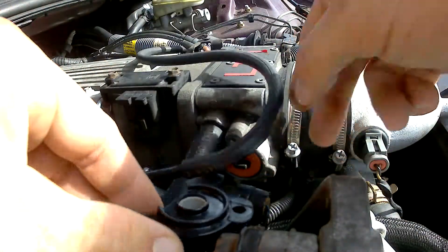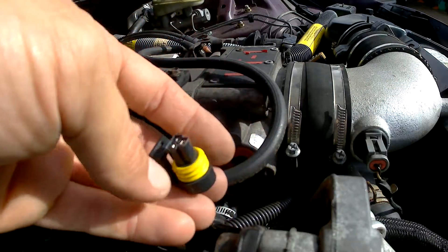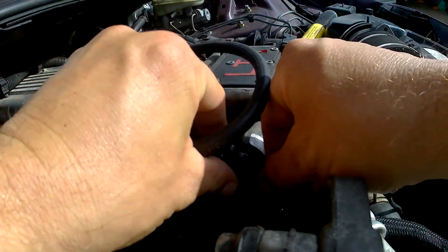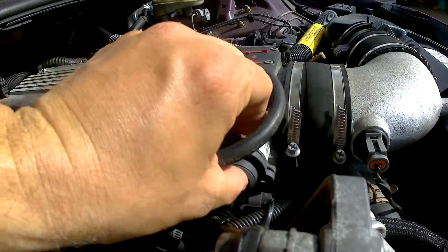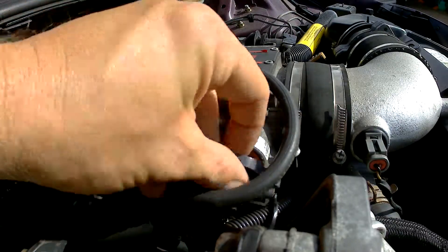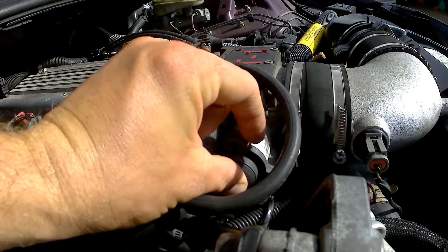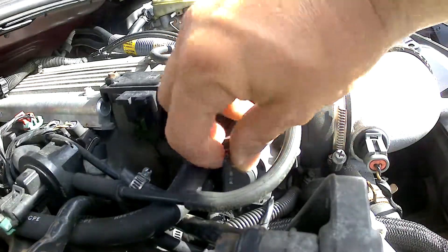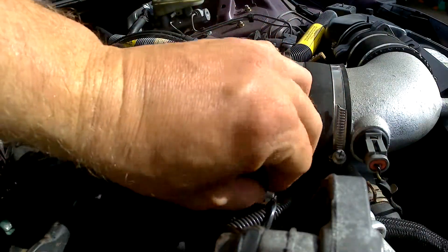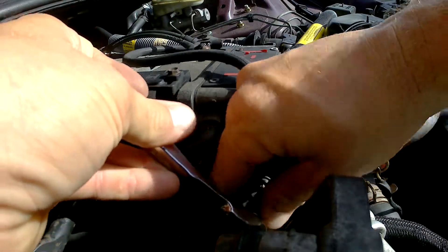There you go. Make sure everything's kind of clean. Make sure you know what you're replacing. Slide it back on. See how it's set here? You've got to kind of rotate it so it fits. Now it's square on — it's a little plastic right here, there's your little square. Slide it here and then rotate it so we can get our bolts back in. Start that one. As always, putting them in even — you're going right into aluminum, so there's no need to mash them down real tight. It's all fine thread, normal right-hand tightening.